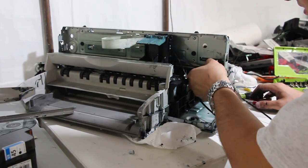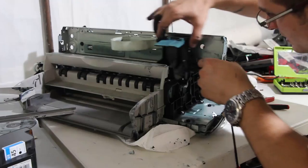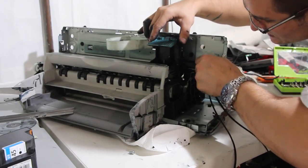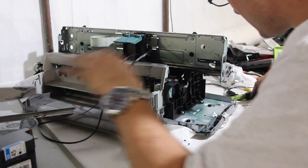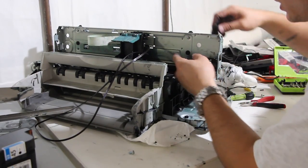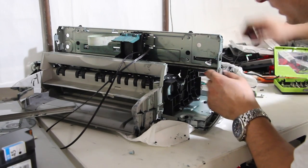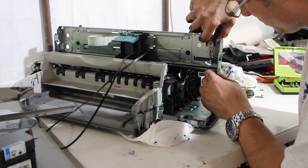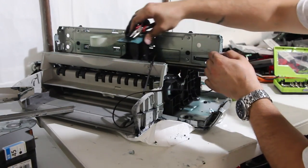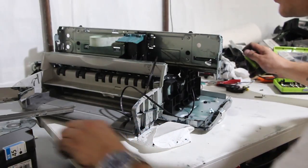So, this is the piece of steel track that this rides on. I'm just unhooking it. I think I'm gonna actually need this as well. Over here, I'm not sure if it can be seen. This is a belt tensioner, so you can't have a fixed distance. You want your belt to be a little bit loose, and so this is almost like a dampener in a car, right? So you put the belt on, and then it pushes it on one side to give it an extra tug, so it's taut, right? It's not loose, it's not too tight, it's just nice and taut. That's what that is right there. Okay.